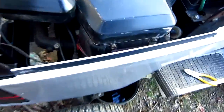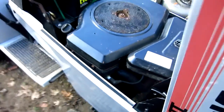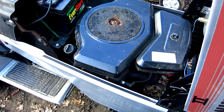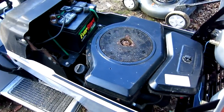However, this is the side that's burning oil, because I think it's the... Actually, no, that's the side that... Yeah, that's the higher cylinder. The higher cylinder, but it's still getting oil in it. So I think the rings are done. And I think that's why it lacks compression on that side. So I'm going to be changing out the rings.